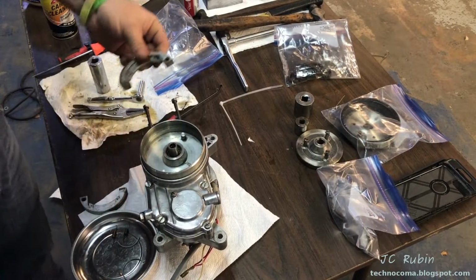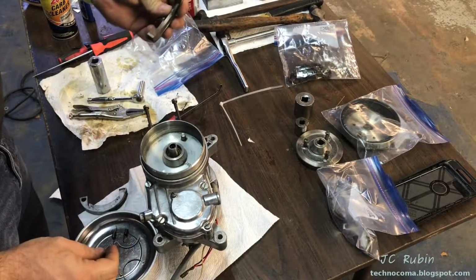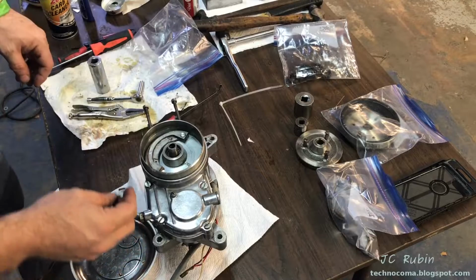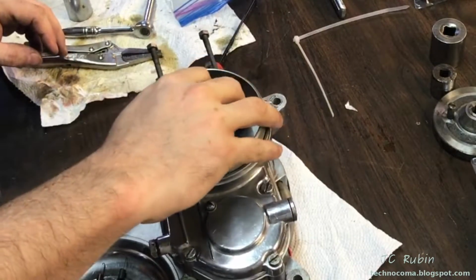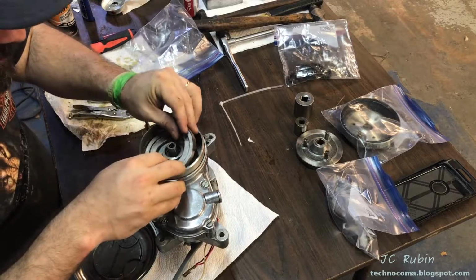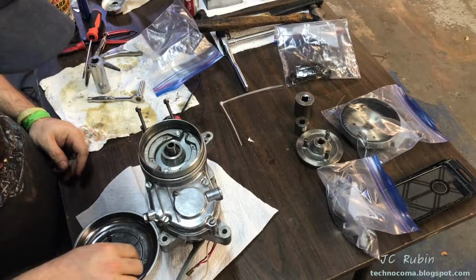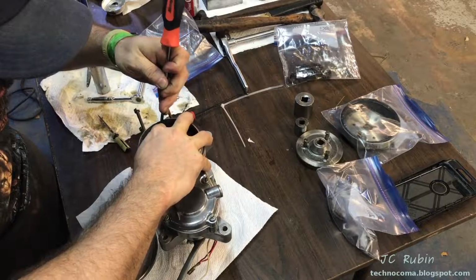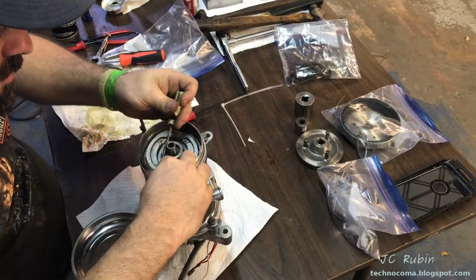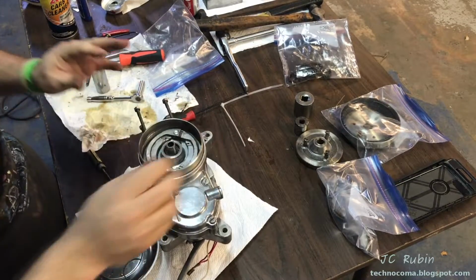The clutches are going to go in now. I remember that the number 5s were facing down, and that's how they'll go in. There are some retainer clips that go in as well once the clutches go in, just like that. And then the retainer clip goes through, just like that. We'll do it with the other one now. Now the springs. There we go, that's finished.